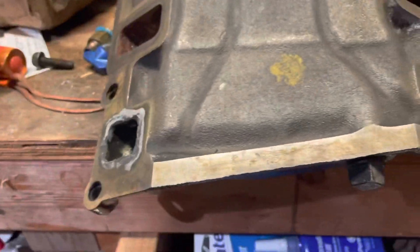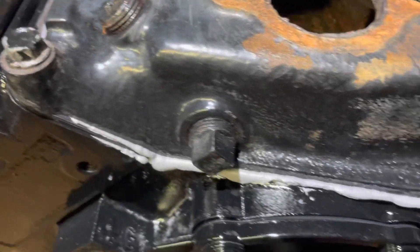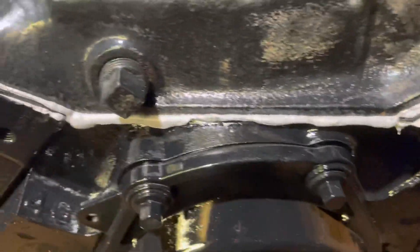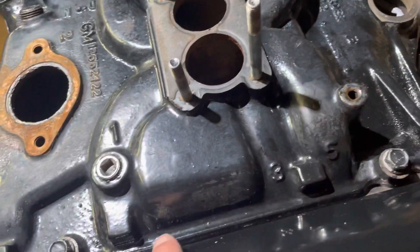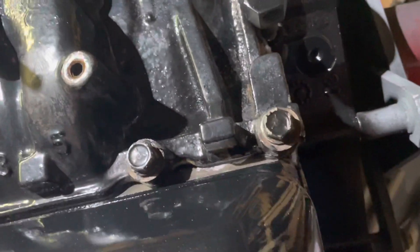The intake is repaired and I'm about to put it on the engine — it's cleaned up and ready to install. You can see I've got the gray silicone ultra oozing out of the front, which is the front seal. That's about the right amount you want coming out. I don't put any sealant on the holes where the gasoline and air flow through. I do use some sealing on the water ports — here, here, here, and here. And there's some more coming out the back, which is about the right amount you want to see. So this is all sealed up.